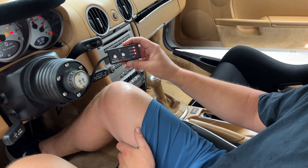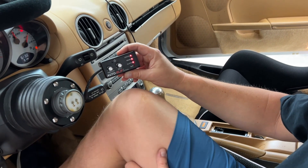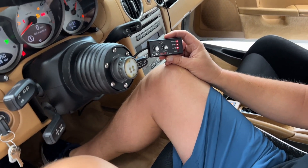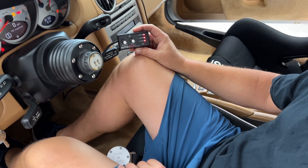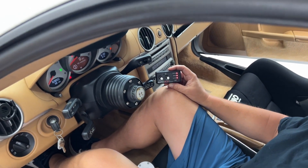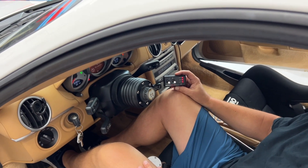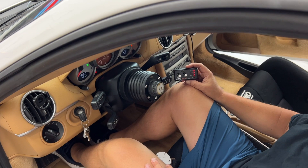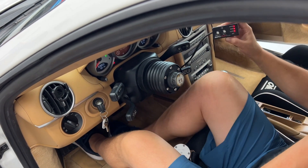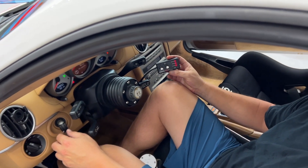When properly calibrated, the brake and clutch LEDs will turn on when the corresponding pedal is pressed. Testing now — brake... clutch. It seems to be the opposite, but maybe that's because we haven't started it. Calibration values remain in memory even if there's a break in the power supply. The auto-blip features a diagnostic function that will warn the user when the calibration routine fails. When a failure is detected, auto-blip will continuously blink the brake, clutch, and/or blip LEDs signaling a failure. Press and release the on/off button once to restart the calibration sequence from the beginning if that happens.